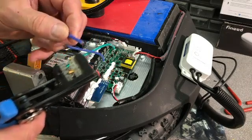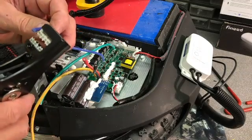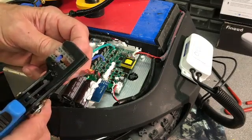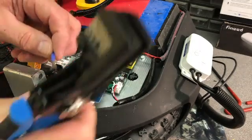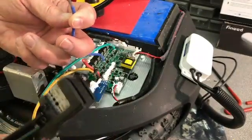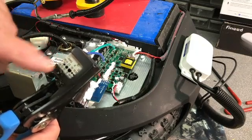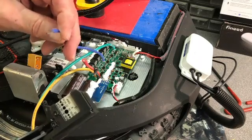Now this is still a 14 gauge, but it's a silicone. So normally I would go 14, but I'm going to drop it down to 12 on my tool here. Which worked out pretty good. As you can see, there's no strands that have been inadvertently cut. This is a really good tool. You can see it has all the different AWG wires, but this is just with this added insulation.